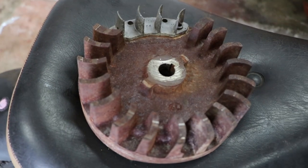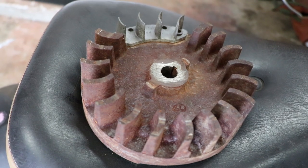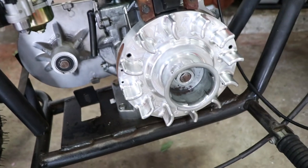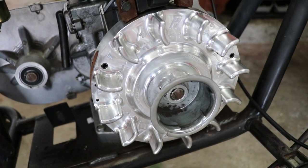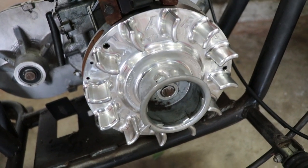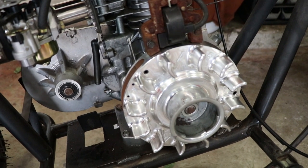So if you look here, this is the old flywheel. This flywheel is cast iron and if you go to high speed, that flywheel right there can fling apart. If you want to hop up your engine and make it fast, you want to get rid of this old flywheel and put on this brand new ARC billet aluminum flywheel. It'll allow your engine to rev faster, actually accelerate faster because it's lighter than the stock flywheel. But most importantly, it'll keep it from flying apart when you've added all these other upgrades — high flow intake and exhaust, billet connecting rod.